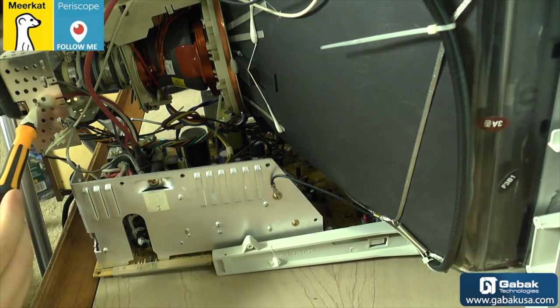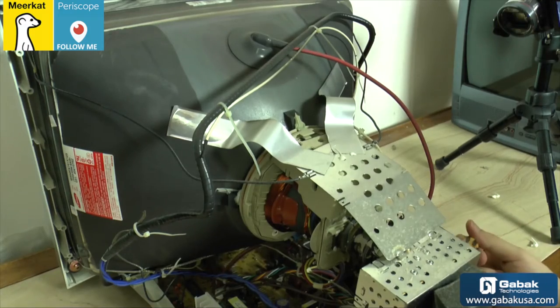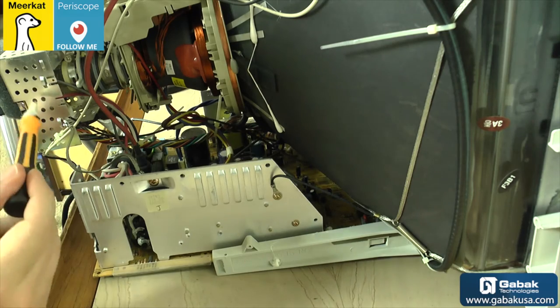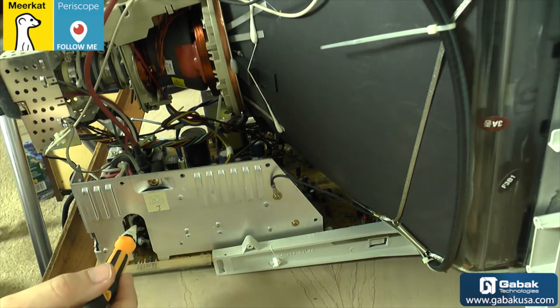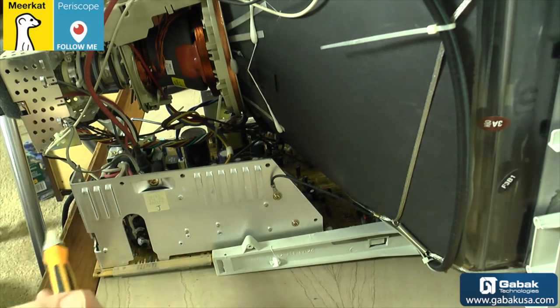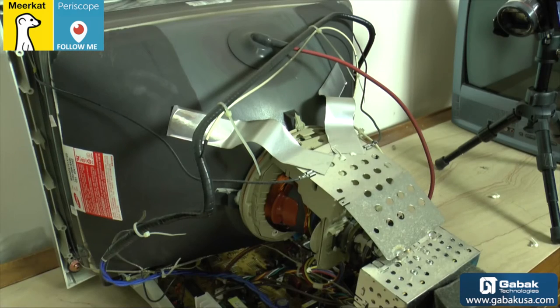Another thing to think about: if you see this piece of metal in this part, it is usually to avoid interference. Also, if you remove that, you can find in some models some presets to move the color, set the colors, or brightness, or any other thing. But basically, as I told you before, in the high voltage transformer called flyback, you will have the focus and the brightness adjustments.